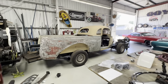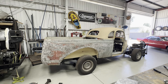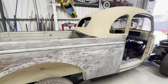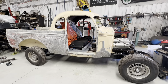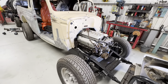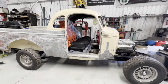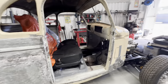This is a new project to the shop. The 55 has now gone to paint, so it's off. This one I think is a '42 Chevy Coupe. The customer has had it for a while — he got the chassis built locally a few years ago. He's been doing bits and pieces but has run out of time and has asked us to complete the project. It's got a fuel injected five litre Holden motor with a four speed automatic gearbox, a Jag front end, and I think it's a Bel Air style rear end with leaf springs. We're going to take it from this stage to completion, so we've got to fabricate a firewall and all that sort of stuff first.